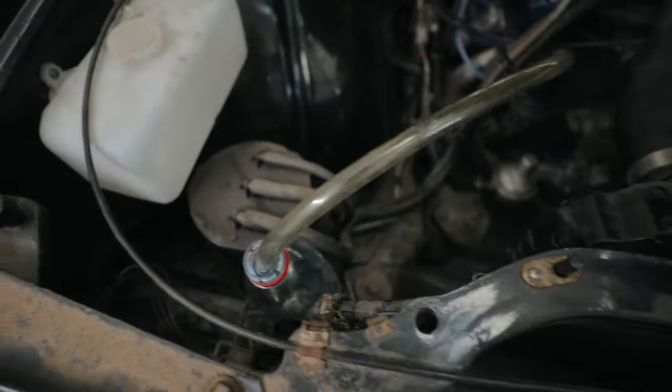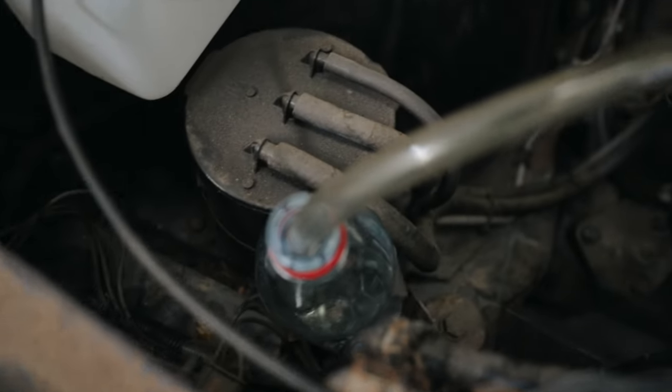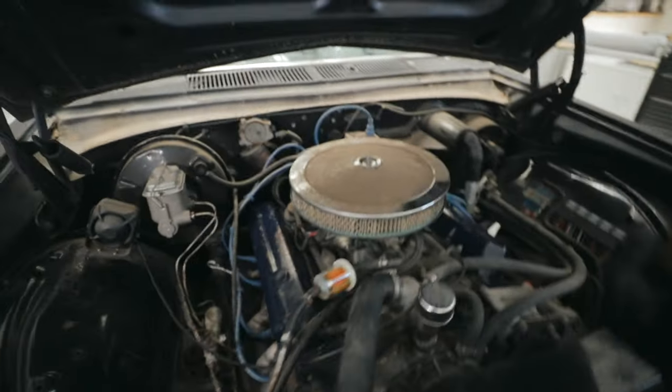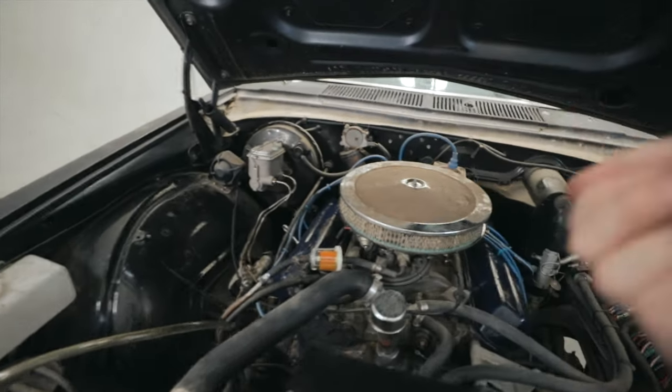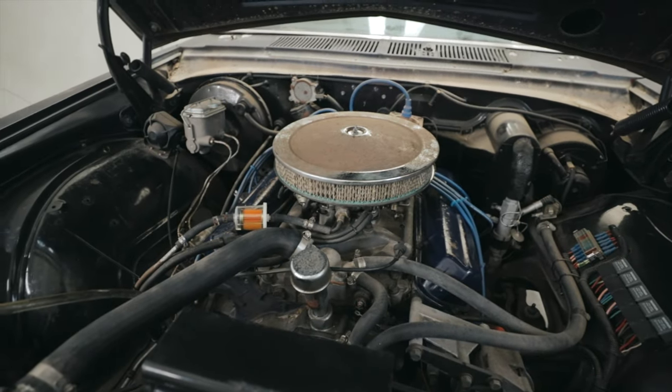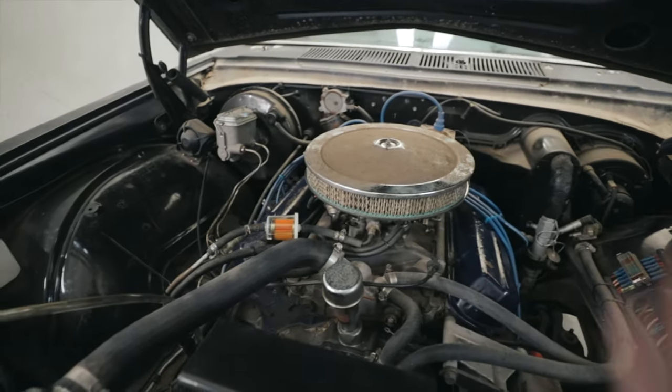Stale fuel in the tank. So this is my makeshift fuel tank right here, little bottle. It's a mechanical pump, so it just literally sucks from there straight into the carby, boom, away you go. I had to prime the carby with fuel to get it going at the start because it was just killing the battery, so I literally poured fuel into the carby.